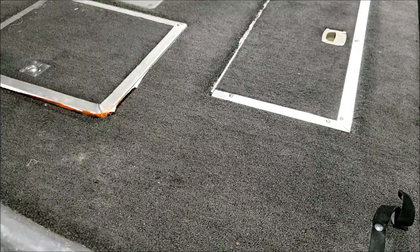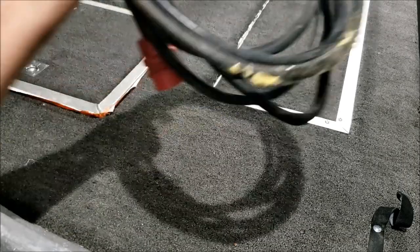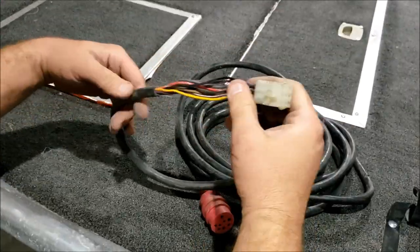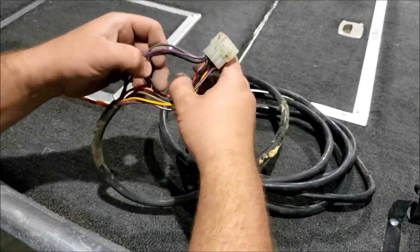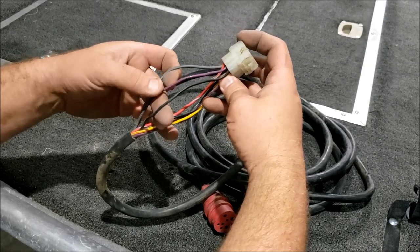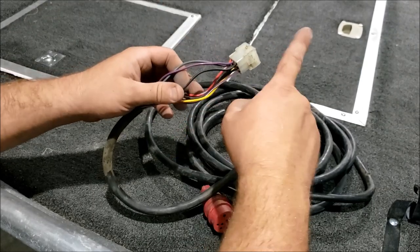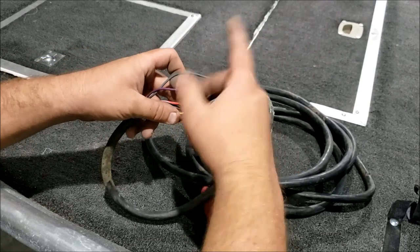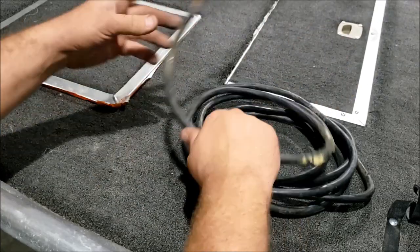If you have a concealed side mount with a factory boat plug, you do have a red plug harness. On the back of that red plug you'll have a plug that connects to your factory dashboard, and inside this plug we have our gray wire, purple wire, and black wire - everything we need to install the tachometer. Keep in mind purple and black are used elsewhere, so don't cut them - strip and tap in. The gray tachometer signal probably goes nowhere else so you can likely cut that one.